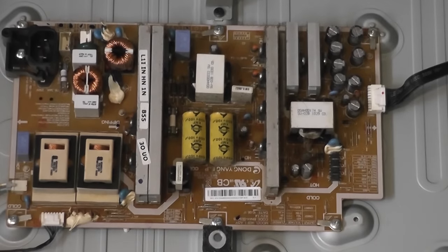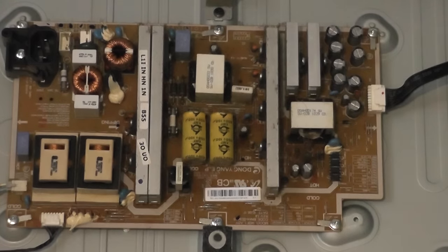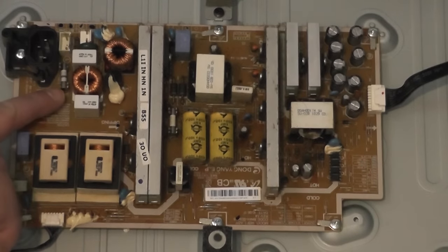Make sure you ground yourself and examine both sides of the board — the top and the bottom. Look for charring or burning around any components. If you see that, that's where it's let go. Here is a fuse, which is your inlet for the TV.